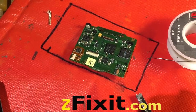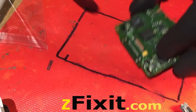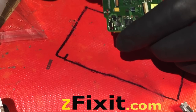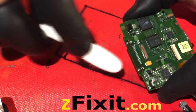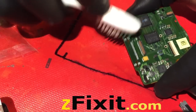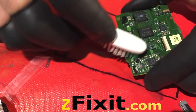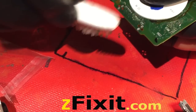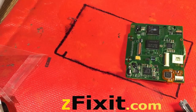The port has been removed. Now I'm just cleaning it up. I always use flux whenever you're soldering — you don't want to ever skip flux even though your solder core might indicate it is rosin flux. I always use additional flux as it just melts off and evaporates. There are four anchor points on the charge port, then 30 points that allow it to communicate to the iPod. Use 99% alcohol — never use 70% or hand sanitizer from the grocery store, as it has moisturizers that will leave a residue. Also clean your toothbrush as the rosin flux tends to accumulate on the brush. Never recycle used alcohol — throw away whatever you use.